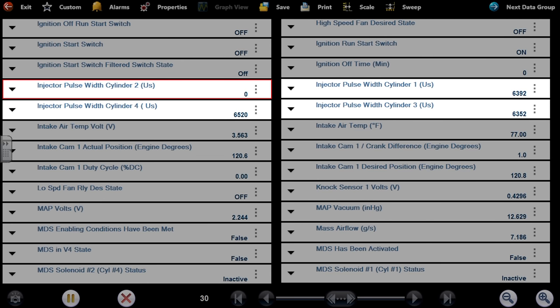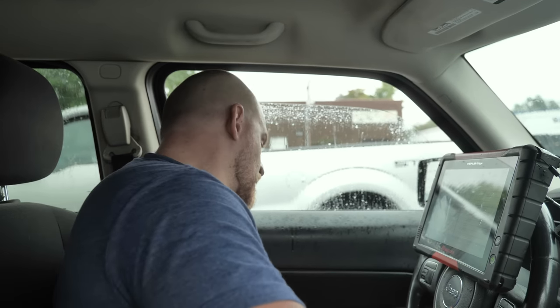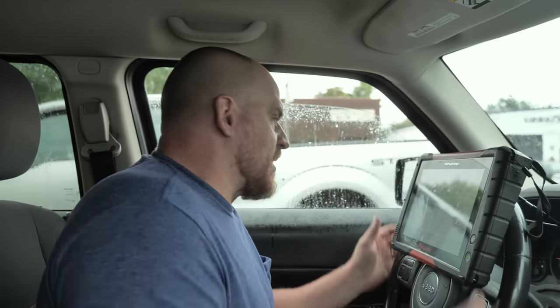This was an immediate right-from-startup misfire. Looking at injector pulse width on cylinder two - notice the pulse width is completely missing. That's in microseconds, so 7,500. The others are hovering between 6,400 and 8,000 - move the decimal point and that's about 6 to 8 milliseconds. Cylinder two just started firing again briefly. There's no reason to test drive this right now. I don't want to drive it long - I have no power steering.